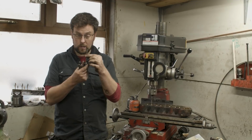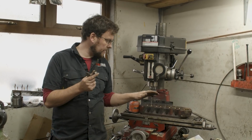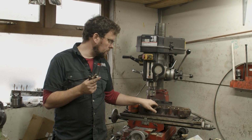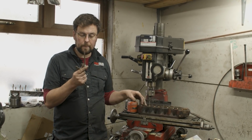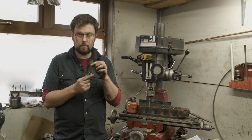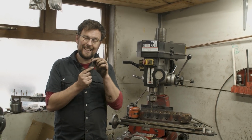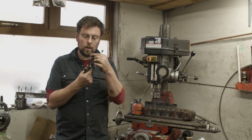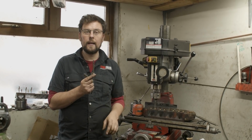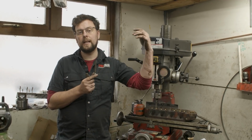The guide is touching the valve, and it is taking the heat and sending it into the water jacket in the cylinder head. If you were to just simply push the guides into the head without reaming them, the valve may well fit into the guide. It may not go in at all, but it may well fit in, but it won't actually sit in such a way that all of the face of the valve stem is touching the valve guide. The less surface area of the valve stem that touches the guide, the less chance heat can come out of the valve.